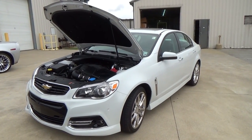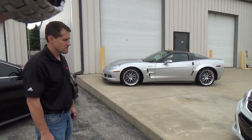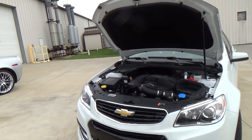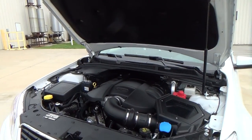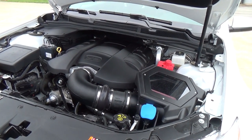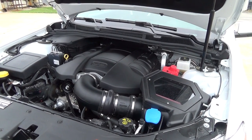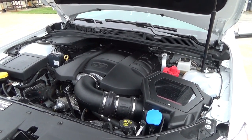The new SS Chevrolet is out and Jeff is here to tell me a little bit about what Lingenfelter did. It's hard to wrap your mind around this one — it doesn't even have the same motor in it. This guy bought an SS, spent the extra money, then sent it right here and had them take that out and put something else in. They did their naturally aspirated 427 package — essentially a different short block with LS3 cylinder heads and their GT11 camshaft — claiming 570 horsepower at the flywheel.